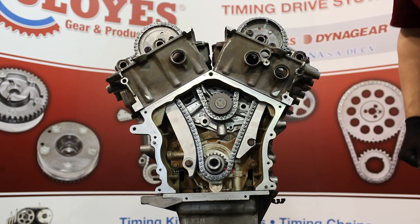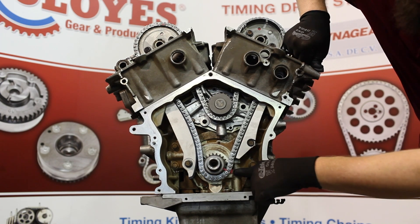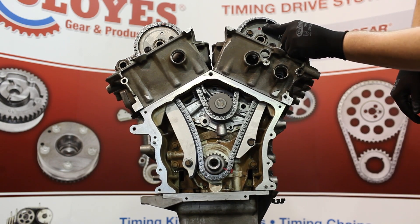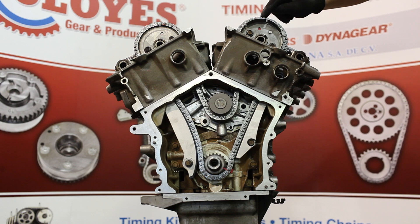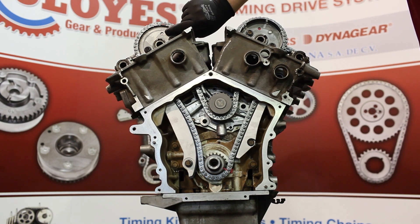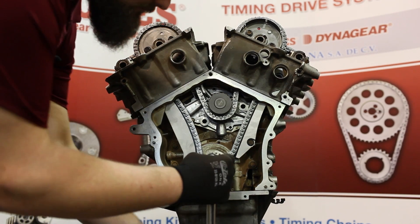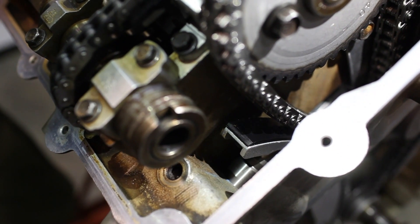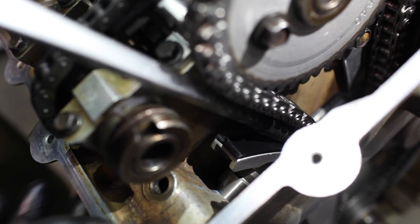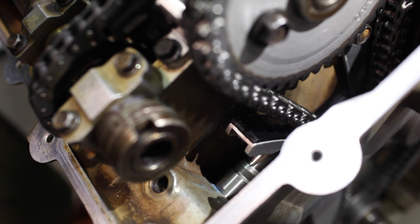Before we activate our timing chain tensioner we're going to want to check our timing alignment one more time. You're going to want your crankshaft sprocket timing mark aligned with your chain timing mark aligned with the mark on your oil pump. You're going to want your cam sprocket mark right around 12 o'clock sitting between the two timing marks on the chain on your left cam, and the timing mark on the right cam pointing straight up at the timing mark on the chain. Now rotate the crankshaft clockwise to shift all chain slack to the tension side. Activate the tensioner with a soft tip pry bar, using the right hand cam sprocket as the pivot point and the pry bar tip pushing straight in on the tensioner guide and tensioner until activation. The tensioner will spring out once activated.